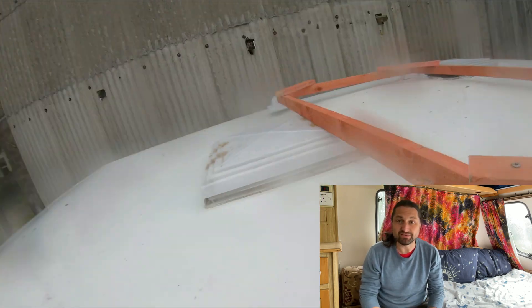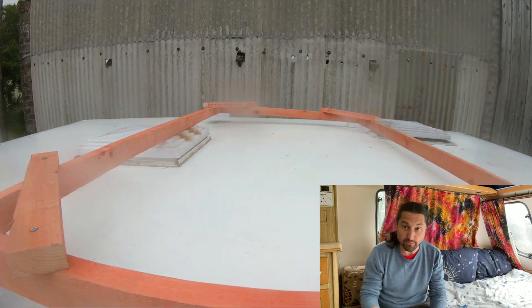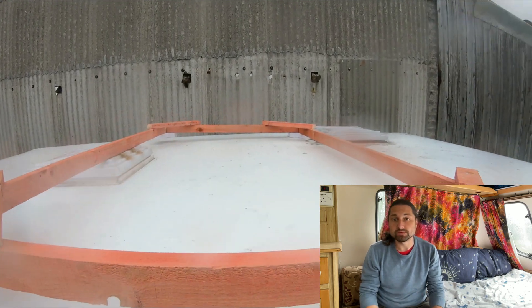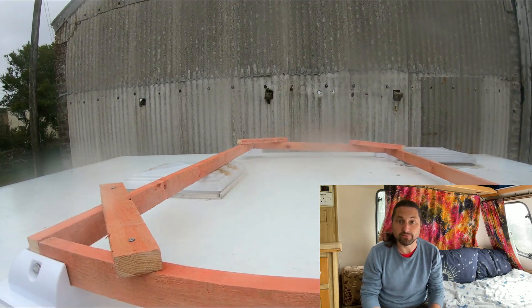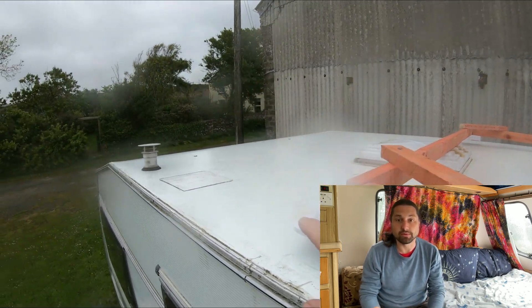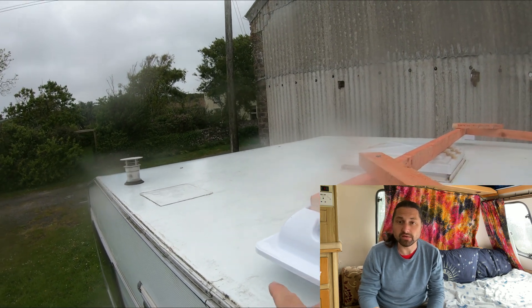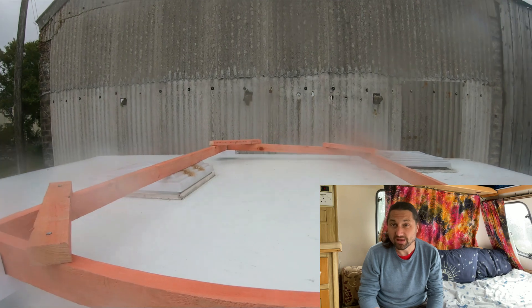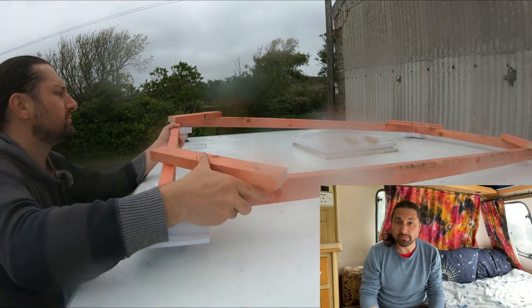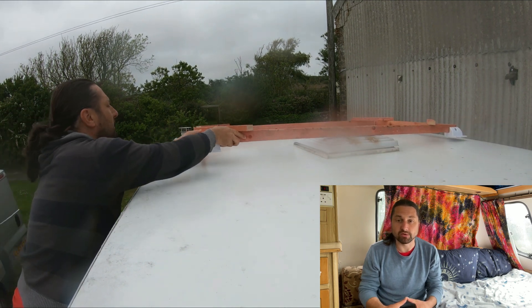During a trial fit we discovered a difference of between 3 and 4mm between how the panel fit in the foot packs and how the wooden frame fitted. Whilst this difference was not a lot, I was reluctant to fix the foot pack to the caravan roof using adhesive only to then find that they were located wrongly when fitting the panel. From experience I know how well the adhesive I was planning to use sets once cured and it is a real bugger to remove. In any event the timber frame was useful in helping me to decide where the panel should be located on the caravan roof.